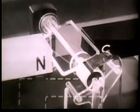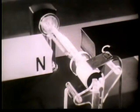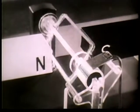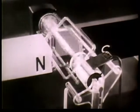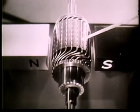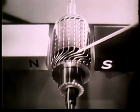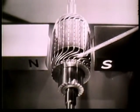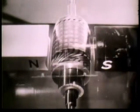In this way, the starting motor changes electrical energy, as represented by the flow of current, into mechanical energy, as represented by the rotation of the wire loop. However, since a single wire loop will not develop enough power to be of any consequence, many loops or windings are required. Each winding must have its own pair of segments. Now, if we space these windings around an iron core, we have what is called an armature. The actual connections and arrangements of the windings are such as to allow a maximum amount of current to flow through the armature coils when they are in their proper relationship to the pole pieces. This allows each winding to add its turning effort to the others, so that they all work together to rotate the armature.